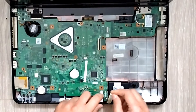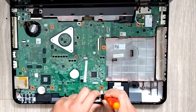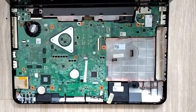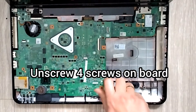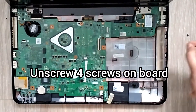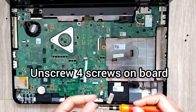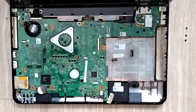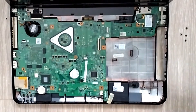There's a small connector there - just apply some pressure and pull it down. You don't need to remove the fan cable because the fan cable will still be intact. There'll be around four screws on this board at various places marked by arrow marks, and you can remove them one by one.